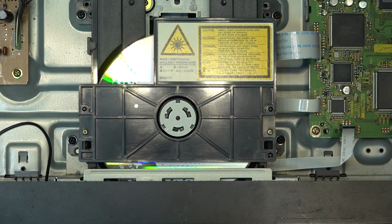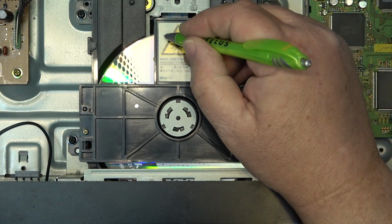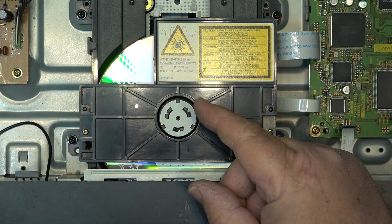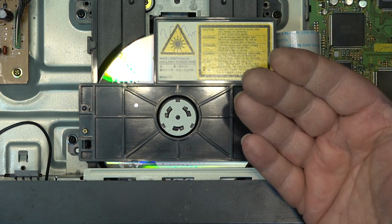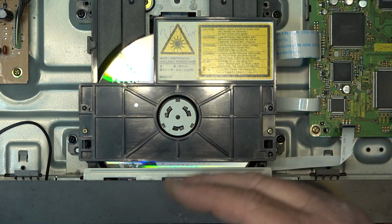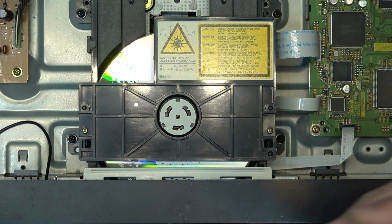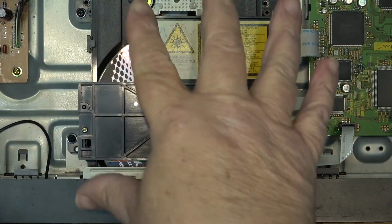So on your regular infrared, you've got a relatively large wavelength, and on the red you've got a much smaller wavelength. The red passes right through the dye layer and gets reflected by the reflection layer. But since there is no contrast, there's no detection of focus, so the system just hunts. That's why you saw the spot getting larger and smaller as the lens was hunting, trying to lock on the focus, which it'll never do. This is first generation.